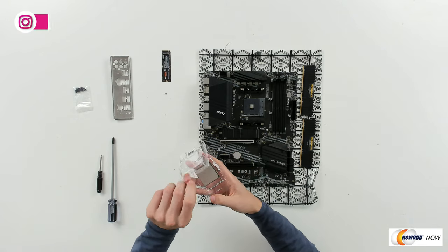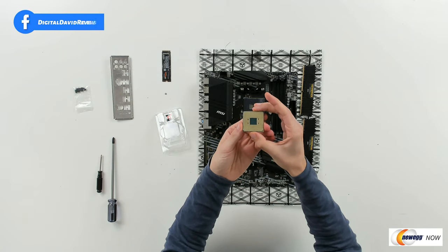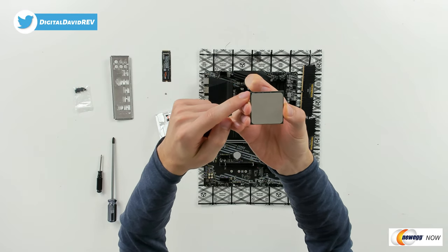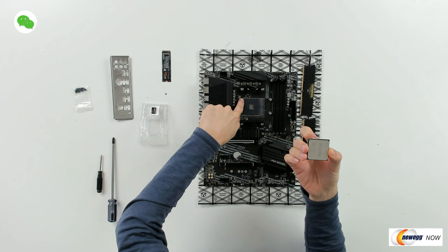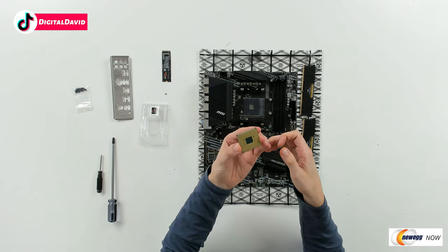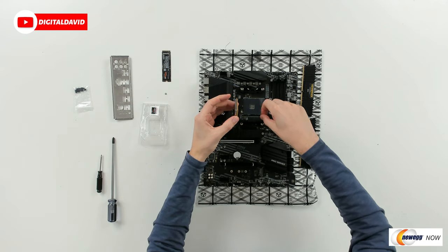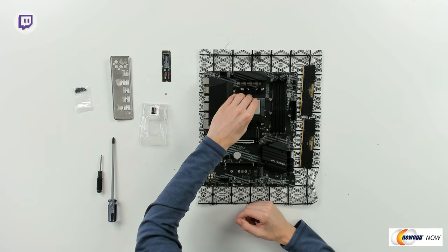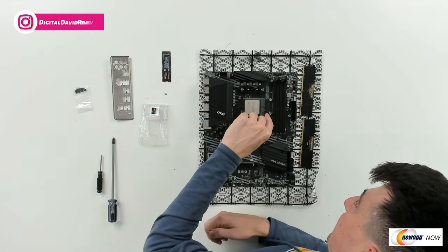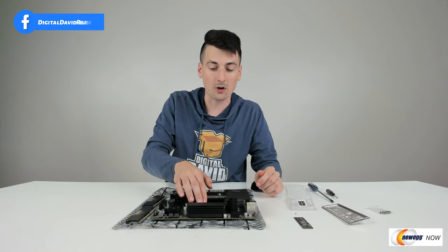So here we go. We can take it out of the packaging very carefully. You can see we got all of our pins on this side. And what we're going to do when we install the CPU — if you look up close, there's a little golden triangle on one corner of the CPU. That's going to match up with what I call Pac-Man. So you can see we have Pac-Man right here on the board, and that's where that piece is going to go. You can see the triangles on the other side too in the case of this specific processor. We're going to open this lever up so we can just gently place it in. So you can see it falls right in. Everything's lined up perfectly. And then we just take this little lever and tighten it back down. We just successfully installed the CPU.